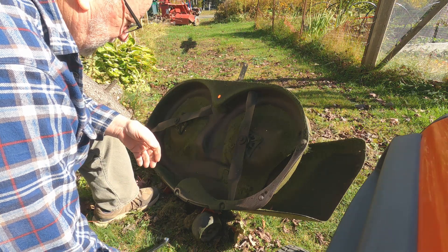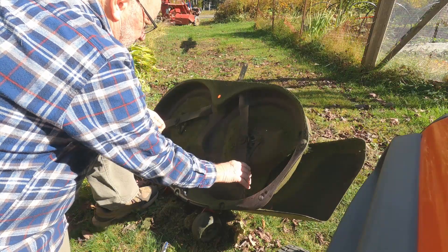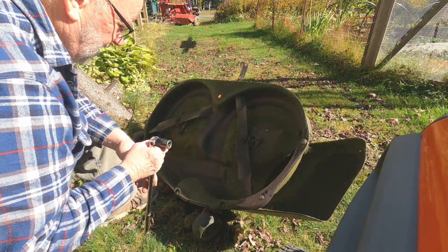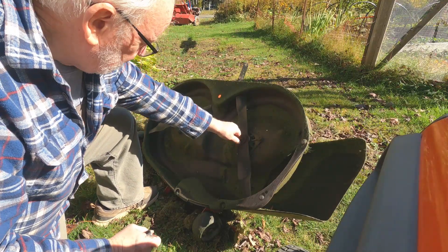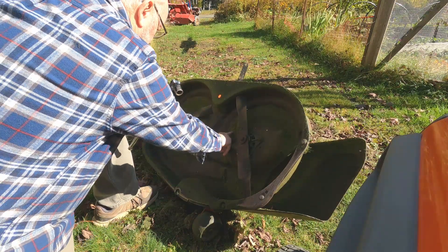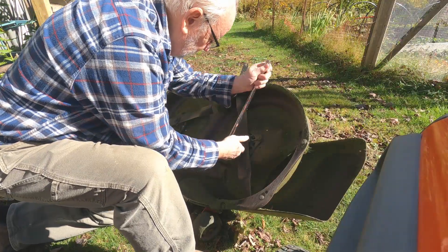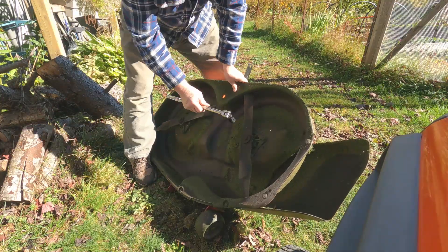I had to take my deck off because when I was trying to change the belt, I noticed this blade was pretty loose — the bolt that holds the blade on was loose. Holy crow. Remember when I changed these blades, I put Never-Seize on there because I was afraid they would seize up, but apparently that's not the case. One thing though — looking at this deck after running it all summer, she's pretty clean really, good shape. Anyhow, we're going to try and tighten this up and see how I make out, because we don't want the blade to come flying off at me.